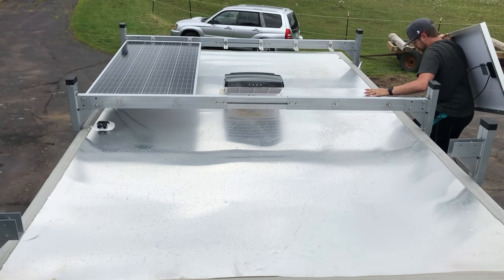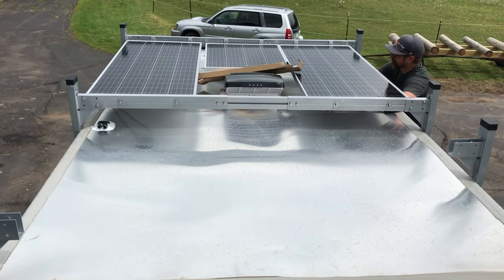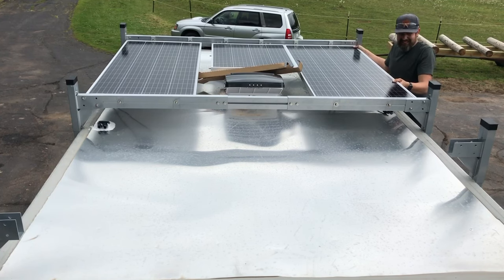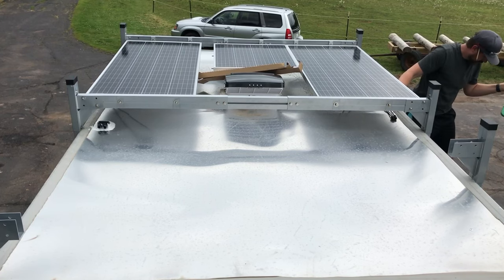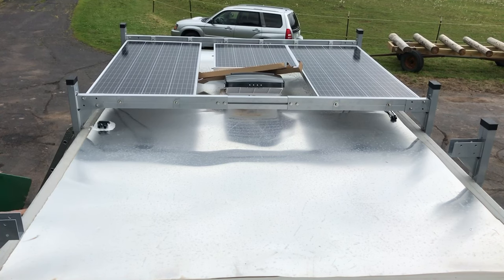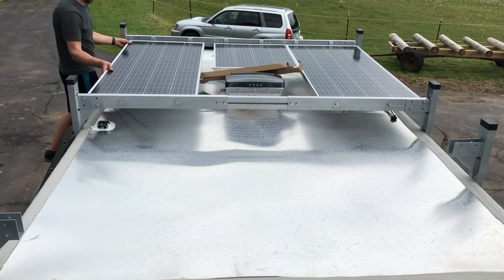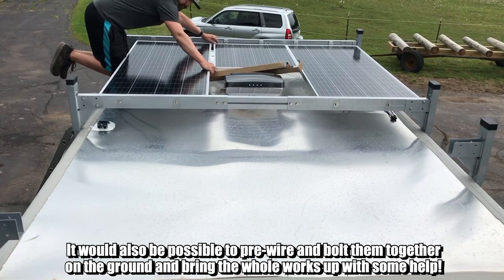Anyway, here I am finally putting the solar panels on the ladder rack. The 100 watt panel is going to go in the middle. I have a box underneath it to kind of keep it aligned so that I can put the bolts through to secure the panels to each other. If I could make one more suggestion, I would add aluminum angle on the front and back of these panels. That would tie them all together, sort of hinge on those angle brackets, and make it possible to lift up one end, prop it up, wire it — it would make it more serviceable. And it would have made it a lot easier to bolt all the panels together, since it was too far of a reach for me to easily get to the bolts.